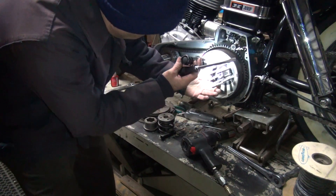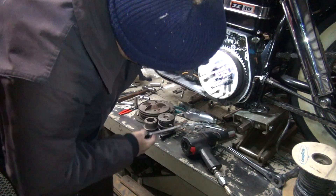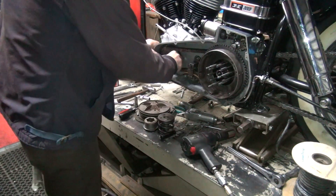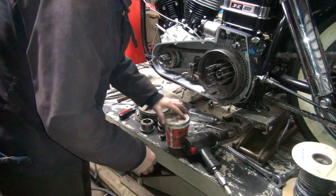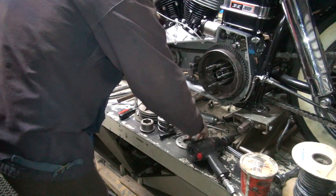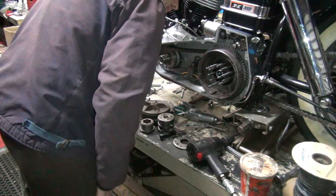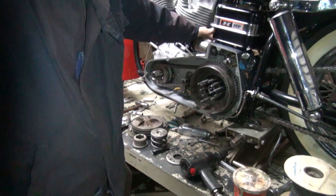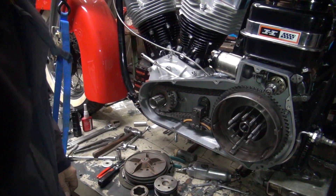Where's my lock tab? Looks like that one right there is a good one to use. It's got Loctite on it anyway. Alright — I'm going to put the compensator on. Actually we don't have to put the compensator on just yet. We don't have a clutch in this bike yet, no way of releasing it. I'm going to pull on that lever back there to make the clutch release, but I have no way of disengaging the clutch right now very easily. I will.